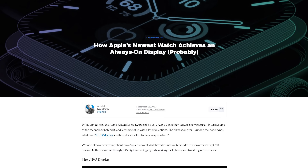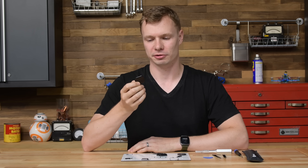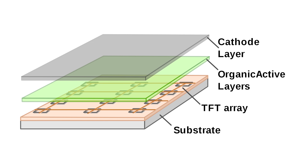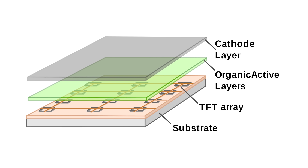For me, though, the most interesting change in the Apple Watch Series 5 is something you can't really see: it's the always-on LTPO display. What is an LTPO display? I'm glad you asked, because I wrote a giant blog post about it for ifixit.com. The display on an Apple Watch is an OLED display, much like a smartphone, and the type it is is LTPO, which stands for Low Temperature Polysilicon Oxide. There's a different composition of the thin-film transistors that sits underneath the organic material in the Apple Watch.